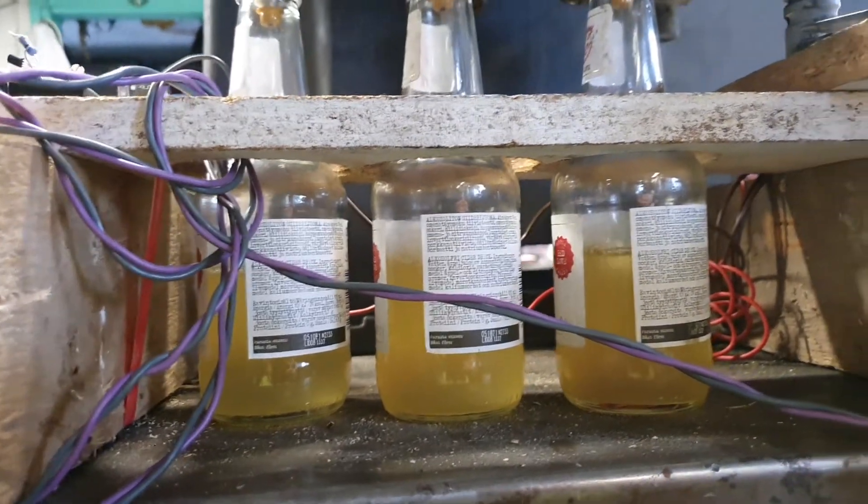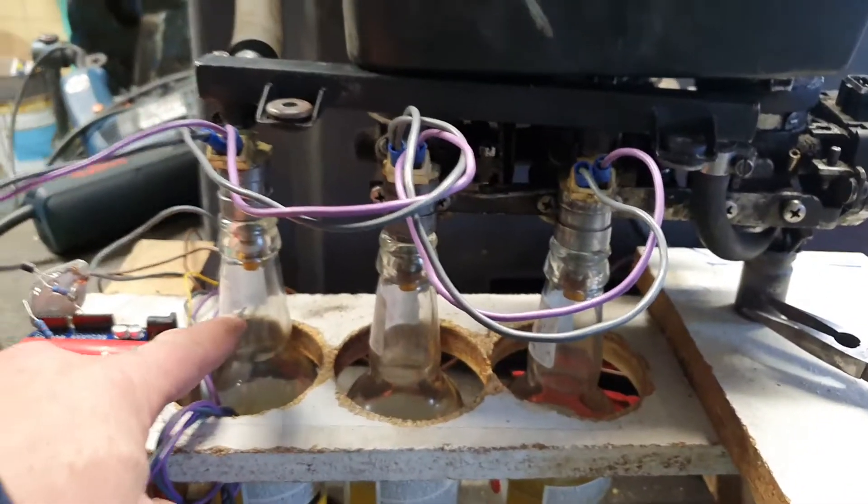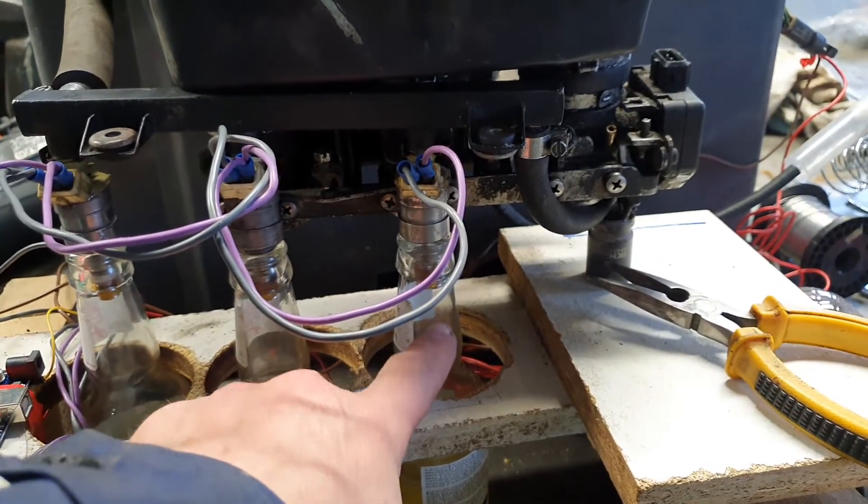There's not much difference between the levels in the three bottles, so I think my injectors are quite okay after all the washing. The regulator is good, the injectors are good. I'll do some 15 tests and after that we'll have the fuel up into the bottle neck, where you can much more precisely see how much difference they make.